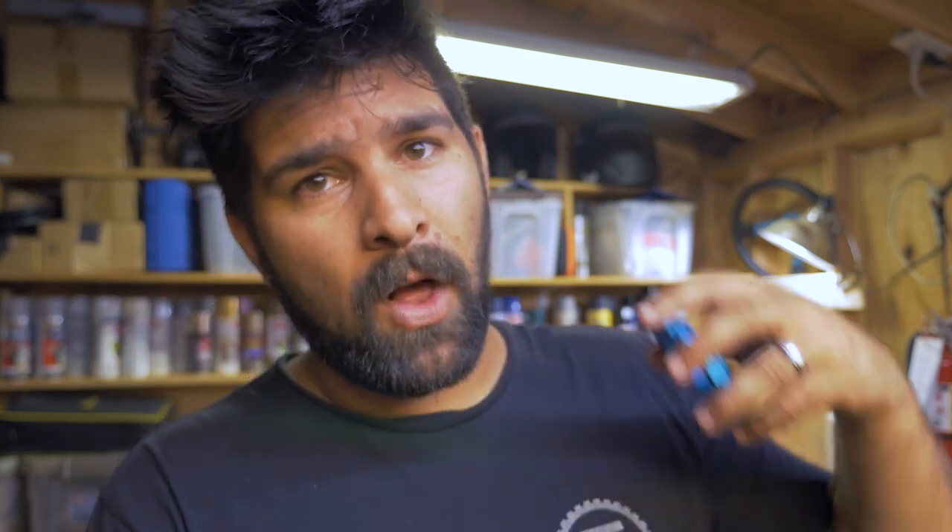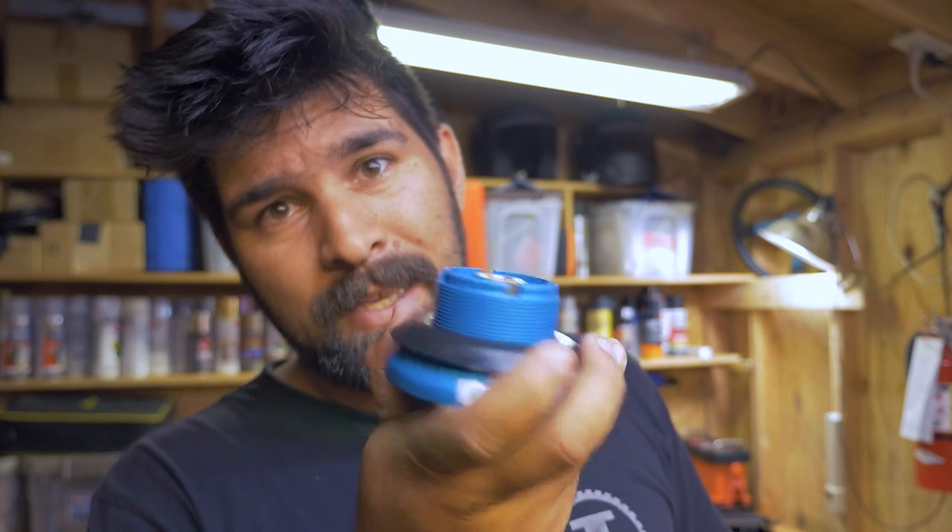These little toppers are solving a problem with the Yaris suspension. Normally with a set of coilovers you might have two or three bolts at the top hat that go through the strut tower. The way the Yaris works is it's kind of like a top piece and a bottom piece that are like very large washers. The problem is that with the OEM suspension this bit is metal, but this piece is a rubber bushing. And now the suspension is so stiff that the actual flex is coming from that rubber bushing, not from the spring. So I need a solid mount so that everything about the spring rate is coming from the spring itself and it's not soft and saggy. Having this is going to make the suspension that little bit more predictable, and with the slightly softer springs, we should get a very balanced setup.